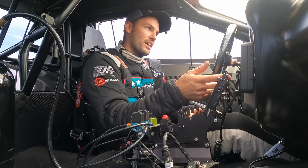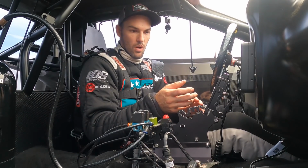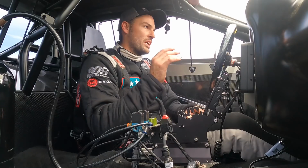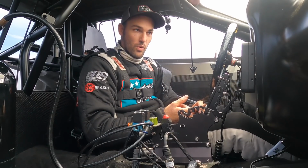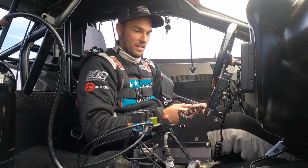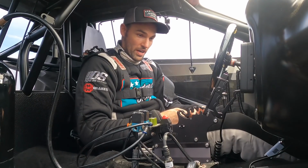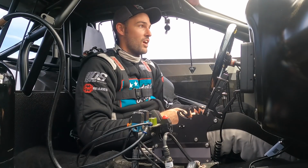Nate programmed in a launch retard, and then that was all the suspension back to the appropriate settings. We had the travel kind of far, so we got that back to where it needs to be. We put a lighter spring on the front end, raised the car a little bit, and moved some weight, and we got this thing scaled like 57-something on the nose now instead of 60%, and the car really liked it. It left, toed at the tire for a good bit, set it down, and rode right down on through there. That felt good. We struggled with the car a little bit the last 2 times out, and we needed that. Solid start for the day.